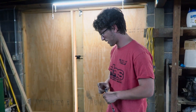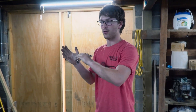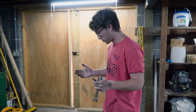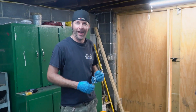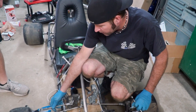So what we're going to do is make it so that on the brakes, it's not going to go past the end and go back to throttle. We're also going to make it so that the throttle only opens up a little bit. Then we're going to add kill switches on the remote control — if anything goes wrong, you flip a switch and the motor dies immediately. Then we should be able to chase it down and figure out what happened and try again. Sounds so simple.